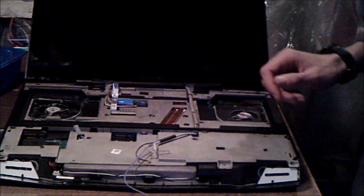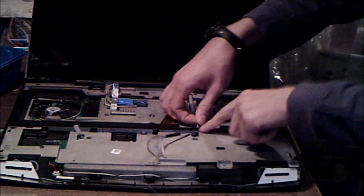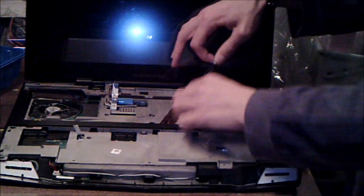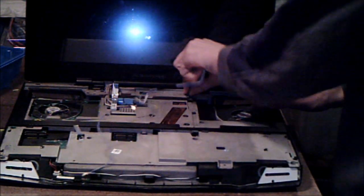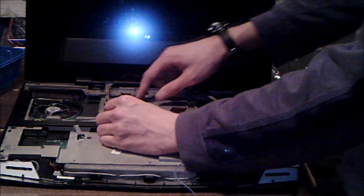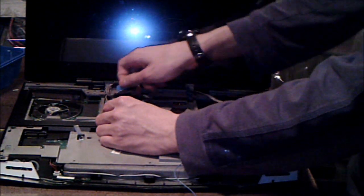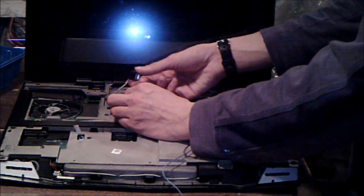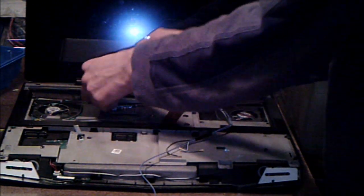Now that we have the video cards out, the next thing is these cables here for your wireless cards. There's a little slot through here — feed them through, and put your screen back a little bit so the laptop doesn't fall over. There's a little notch here; take the cable all the way back to the screen. If you pull this ribbon cable back, you'll see two connectors with little blue tabs — just pull them out. This one here is your video cable, and this one is for your webcam, microphones, and the backlit Alienware alien head light.